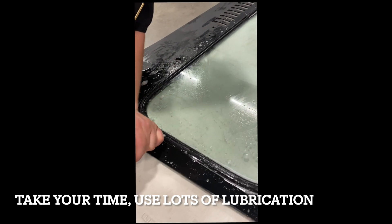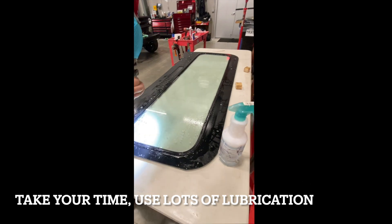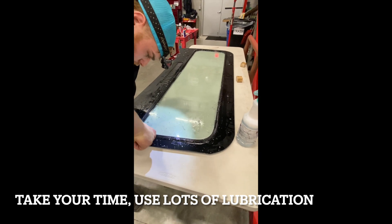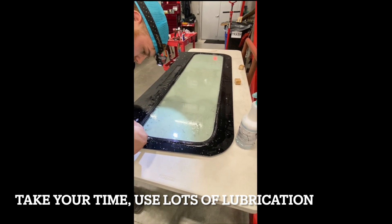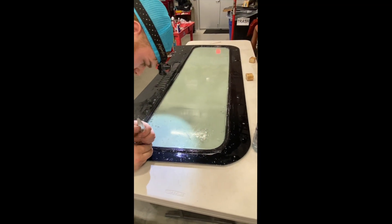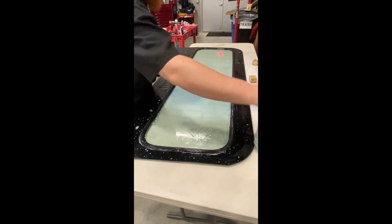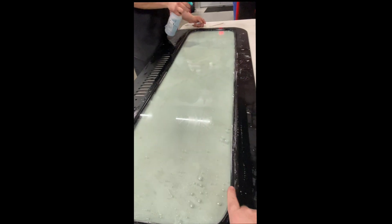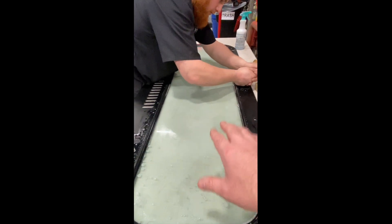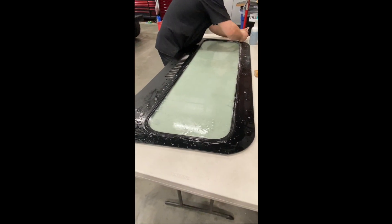The main thing is — we've had some guys be confused with which direction to put the seal in. They actually had the glass fall in on them when they took off down the road. The glass did not shatter, it just came in and they caught it. They had the seal in backwards. So it's important to put that seal on correctly onto the frame — check your J-channel lock so it's on the front side of the vehicle, so that you put your glass in and lock the J-channel on the outside front of the windshield frame. That way the wind is always pushing on the windshield as you go down the road.